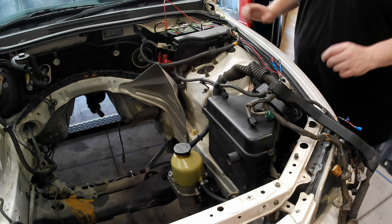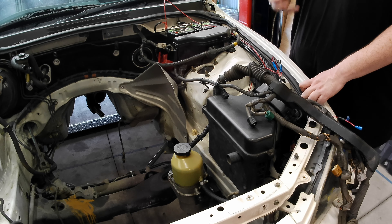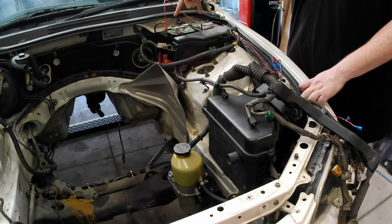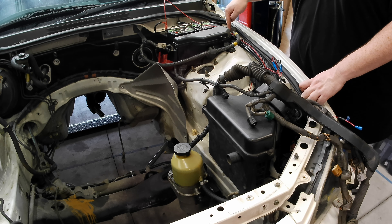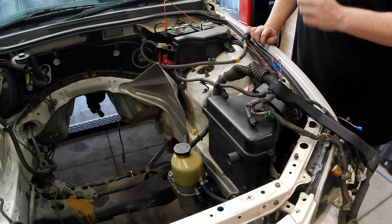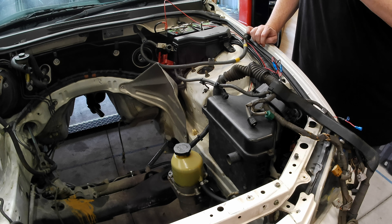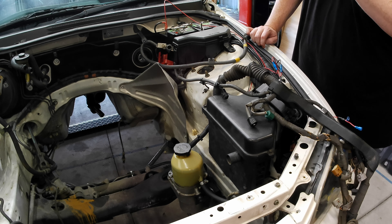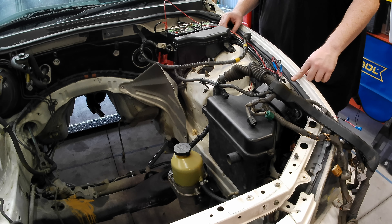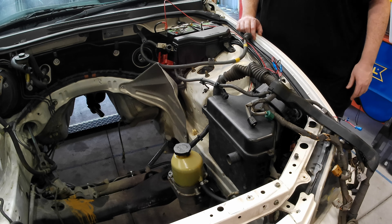I have this set up so I can show you the ramp-up times of the pump, how it turns on, and how to get it to start up instantly. The pump is connected to the battery with its main battery cables through an 80 amp fuse. Don't use one of those audio fuses — the cylindrical type. They're terrible and they melt under hard amperage. They're designed for peaks and valleys, not for constant power, so don't use audio fuses. I believe this is an ANL fuse and I got it off eBay — they're about $30 for a kit with a few fuses, so very cheap.